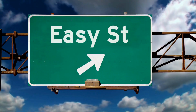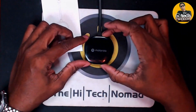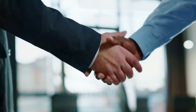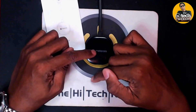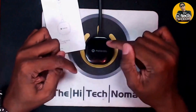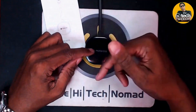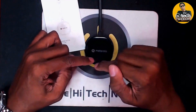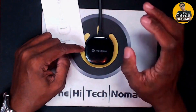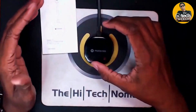The connection method is quite simple. We're going to pair our phone with this the same as we would pair anything else — not so it can talk to it directly, but so that when these two connect, it will tell our phone to go into Wi-Fi Direct 5G. At that point they'll exchange information. The Bluetooth is not to actually run Android Auto; it's just to jumpstart it to get it to the Wi-Fi 5G Direct Connect so that it can move the screens back and forth.